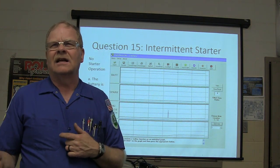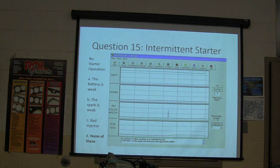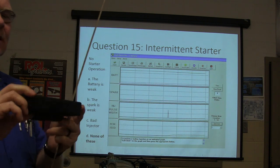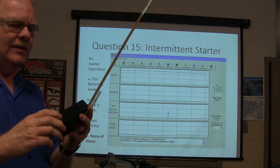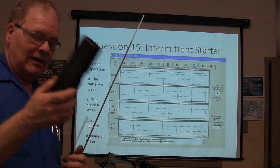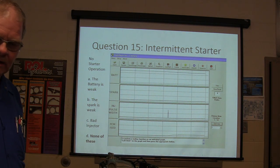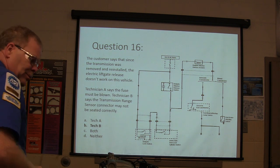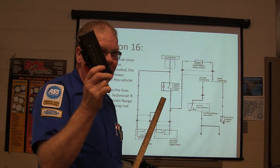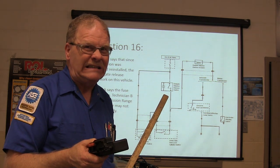And the other day, Charles had a thing in his hand over there. This thing. There's a bunch of relays built into this thing. This right here is what that Chrysler Crossfire has. It's got a whole bunch of relays in it that you can't replace just the relays, and it's $450 for that little module. That's what was wrong with that car. And she never had any more trouble with it after that. But it took that little recording to pinpoint that. It's pretty scary when you think this might be what's wrong. And if you put it on there and it's just like it would, think about that for a minute.